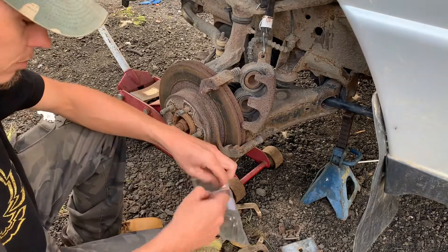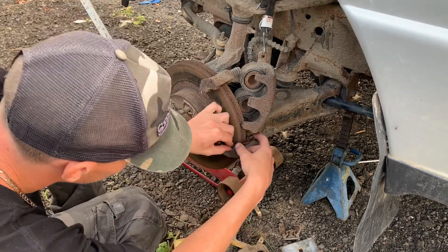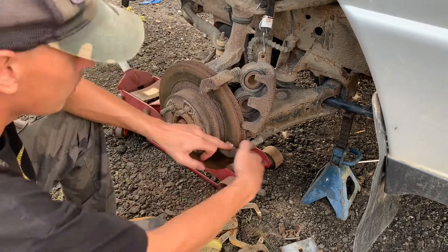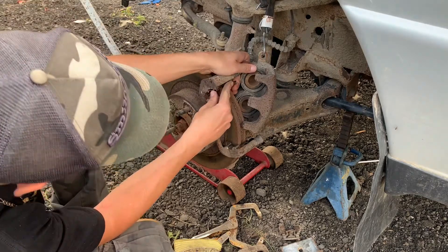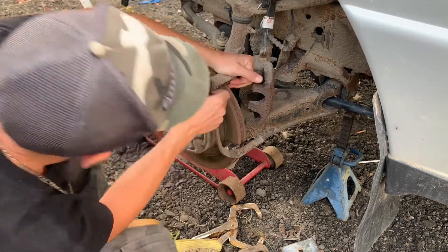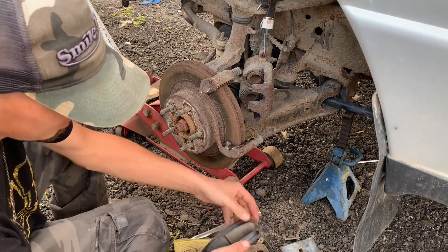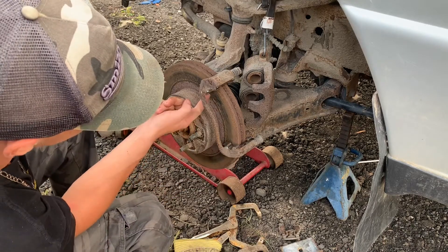The hardware has to go first — the mosquitoes are really chewing on a fella out here. I need to figure out which way this piece goes, and then just stab that into place with whatever size hammer you've got. I'm gonna install these fancy brake pads — should probably put my gloves on. You gotta press on these tangs; other than that they pretty much just go right in.